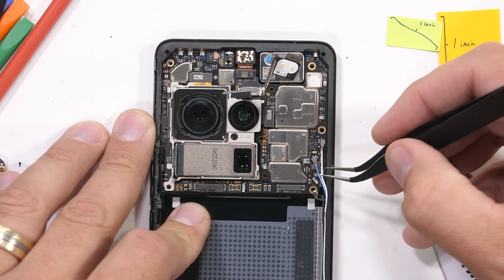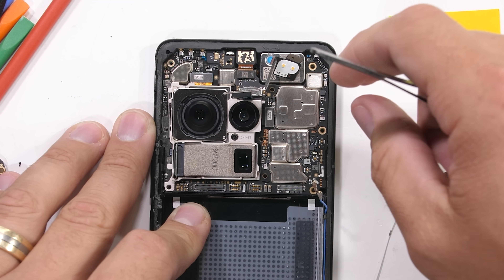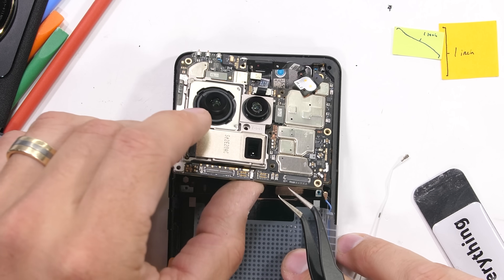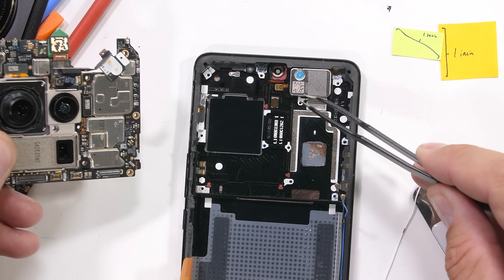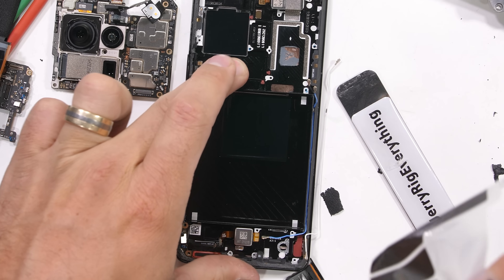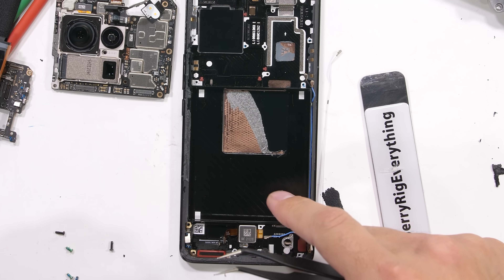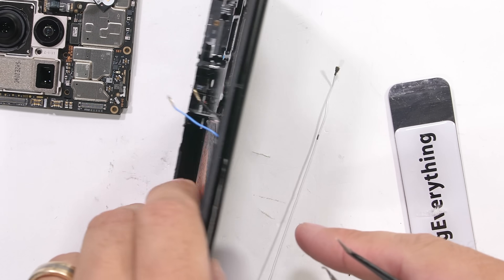Now let's unbury the cameras. The motherboard of Xiaomi's 12S Ultra has a few signal wires and a singular screw holding down the camera units, and then the whole thing can lift up and out of the phone, leaving behind the upper loudspeaker and top portion of the vapor chamber for the liquid cooling. The rest of the vapor chamber extends down into the battery compartment, giving it enough surface area to help dissipate heat out from the front of the phone through the screen.